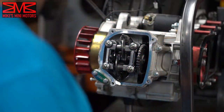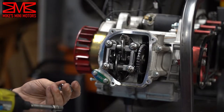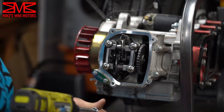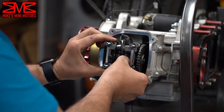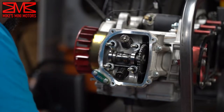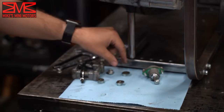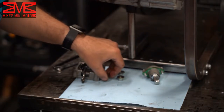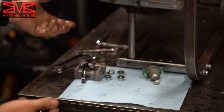It needs to be a 12mm. These are the main studs that hold your head, cylinder, and everything together, and they need to be removed in a cross pattern. When I pull the rockers off, I lay them down in the position they were at — that way when I go to put it back together, I know which ones were where.